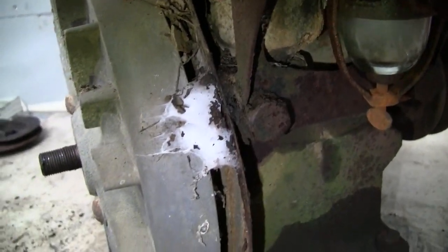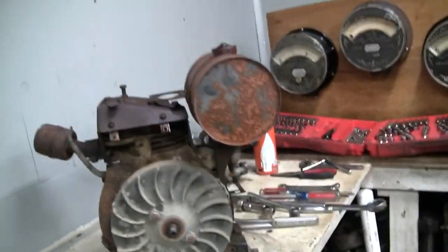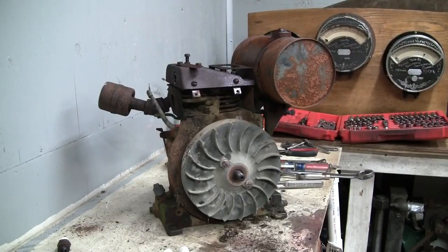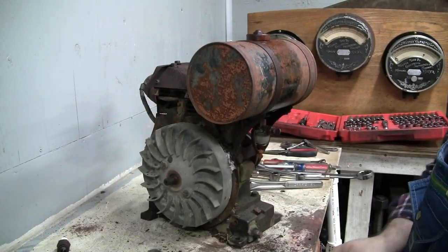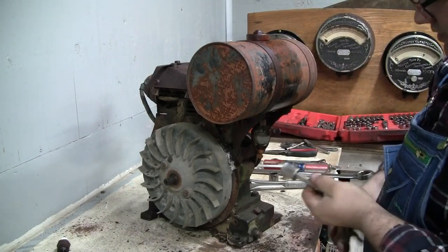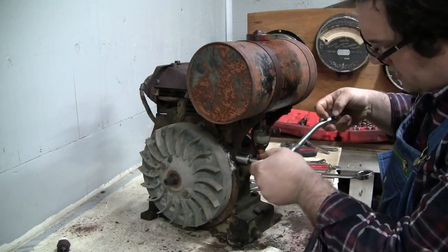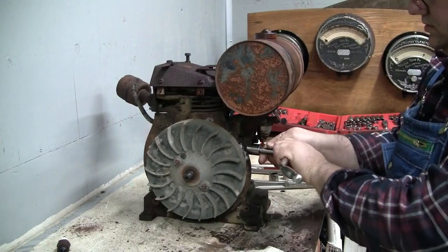But we have access to that bolt now. So let's try to get those off and take the fuel tank off. And then we'll pull the cylinder head. I'm really curious to see what it looks like under the cylinder head. Move the hammer and the impact driver out of the way, and see if we can loosen those 3/4 inch bolts here. Might have to put the impact on these, kind of shock them loose. Try to bump it with my hand first.